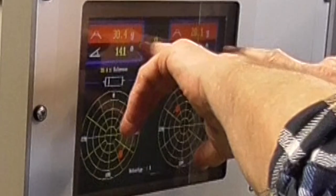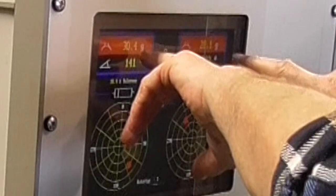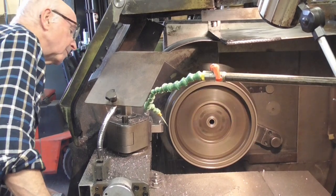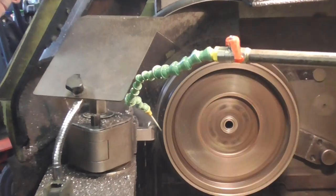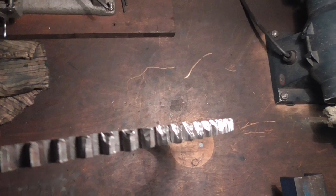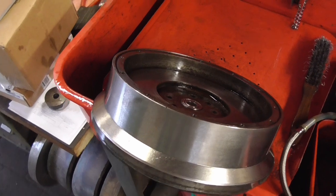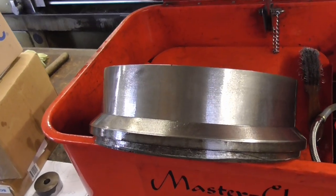And consequently, I decided to machine off the weight difference from the flywheel. This will hopefully give me a little bit quicker throttle response paired with better engine braking, and then of course it's going to reduce stress on the rear main bearing due to less inertia wobbling about. Did I mention the ring gear was chewed up too and had to be swapped? After machining, we had to, of course, balance the thing out.